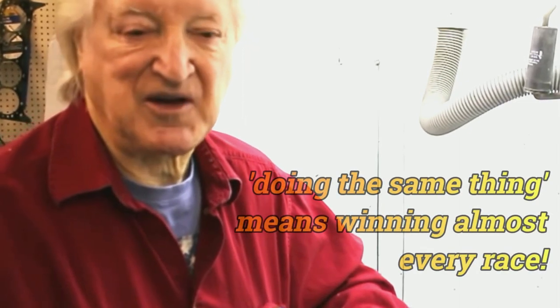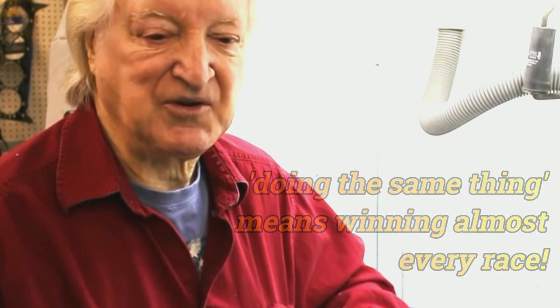Now it's time for something a little different — this you could say is the crowning glory on bathtub chamber mods. I applied this mod as well as the techniques I've just shown you to a TR3 four-cylinder two-litre engine way back when, and it worked very well — the race results suggested it won about 9 out of 10 races. We stopped using that engine because it made enough horsepower to become grossly unreliable and I was rebuilding it after every race, which wasn't good since I was sponsoring the guy. We went to a cross-flow head after that.